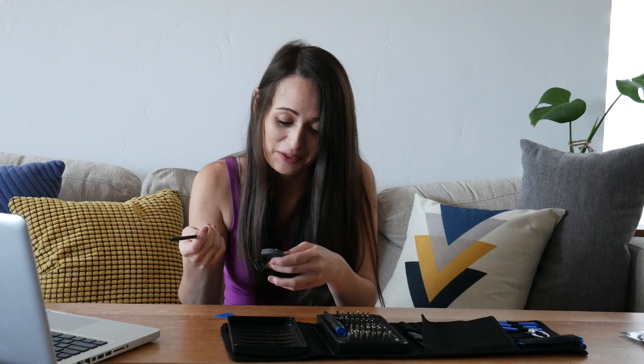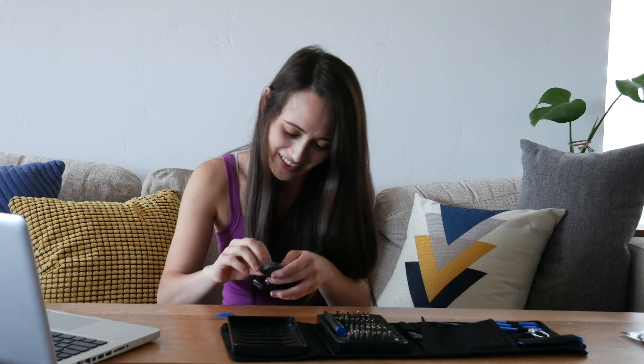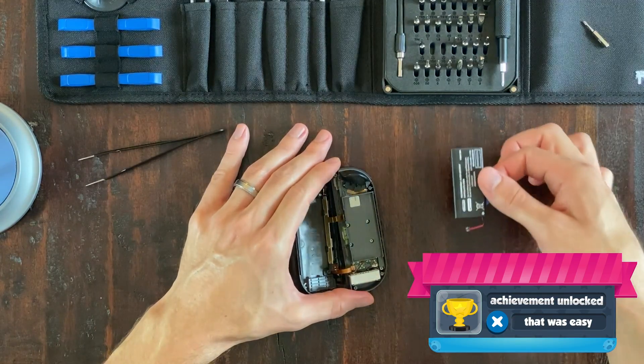This battery connector is really difficult. I am prying with my spudger — I've used both ends. Last resort is to pull very gently on the cables. Good advice for any repair: whenever you feel like something's really resisting you, don't fight it. We're going to get the opening pick out and put it between the battery and its housing. One pro tip: it's a good idea to drain your battery a little before you start. Don't leave it charged at 100%. If you drain it down to about 25%, the risk of anything bad happening is basically zero. If you fight a battery too hard, it can explode. And it just pops right out — great, that was not scary at all.